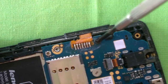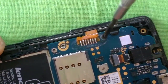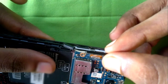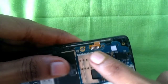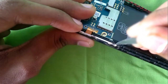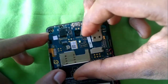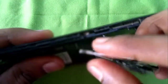Now I'll use a screwdriver to remove the two motherboard retaining screws. Using the pry tool, I'll carefully pry off the ribbon cables from the motherboard. The side switch caps are also removed. Because the side switches are soldered to the motherboard, I have to remove the side switch assembly from the body by slicing the glue using a knife.